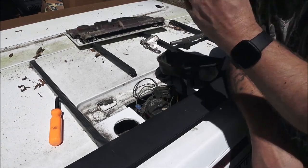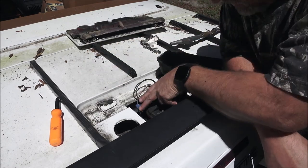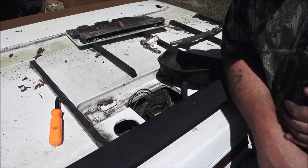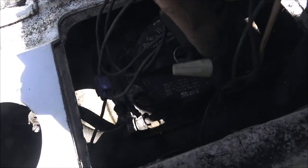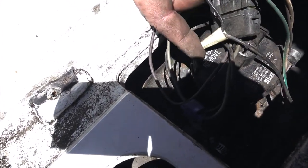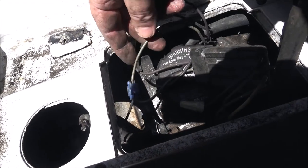Someone's had a problem before. I know he was having trouble with this fuel pump - I've been told that by a couple different people. Is that a power wire coming from the front? Why was this one cut and put back together like that? Right here there's a wire nut - those don't come on cars. And right here is the scotch lock. I don't know why this wire was just cut and wired back together, so let me trace this down and see where it goes.